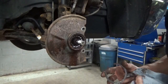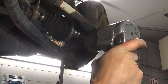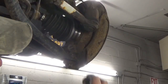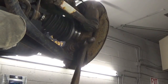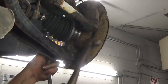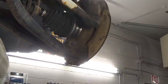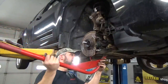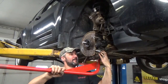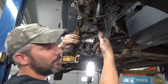Now that we've got that out, we'll pop the ball joint loose and get the hub tamer. We'll take this pinch bolt out by the ball joint. I see it's got an aftermarket ball joint in it - somebody changed that. This job's going way too easy so far. Of course, that CV axle was just done too.